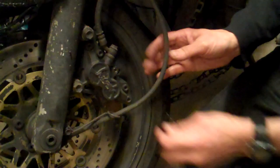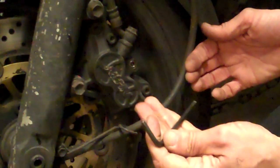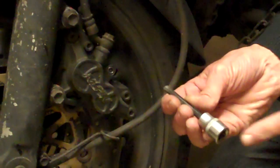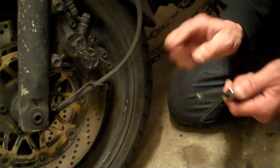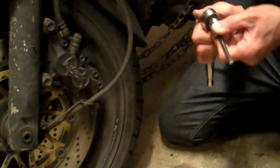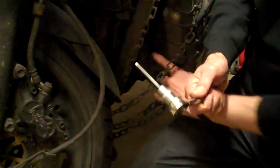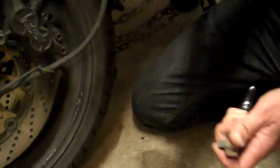These fasteners — this pin holds the pads, and here's the more important one: a six millimetre allen wrench or allen socket. The L-shaped ones are okay for little pins, but six millimetre on a Japanese bike is extremely ubiquitous — you use it for all kinds of things. It's used for the pinch bolts on the triple trees, and even the engine mounts are six mill. One of these is about £25, around $30 in a decent tool store — it's a very wise purchase.